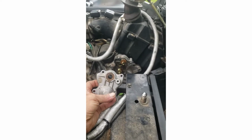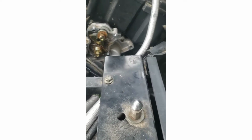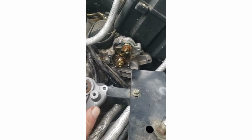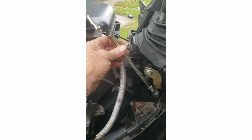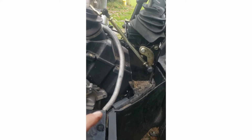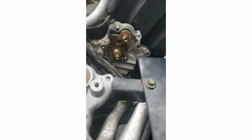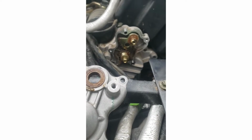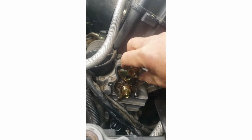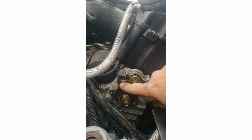Okay, here's the Massimo 500, whatever it is, UTV, that we're having problems with it going into first gear or reverse, depending on how we adjusted this linkage. Adjusting it one way or another, you'd get either first gear at this far end or reverse at this far end, but you wouldn't get both anymore. And I'll show you the pictures of the new part. I'm going to take these off, but I can tell you right now, this is very worn, this gear right here.